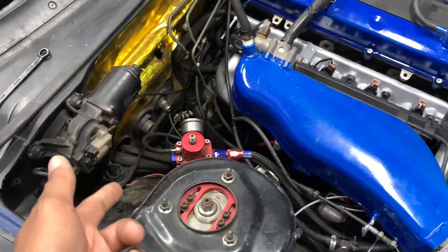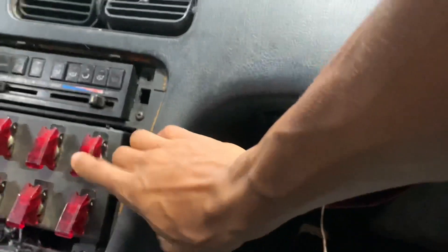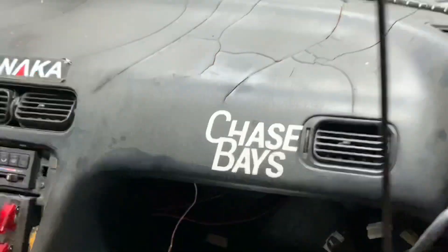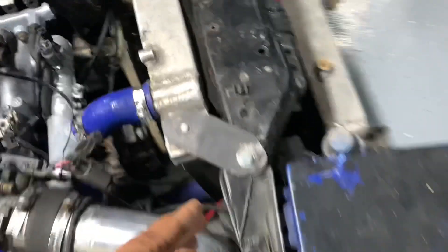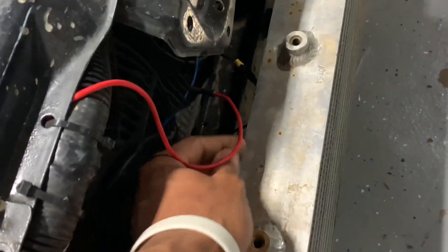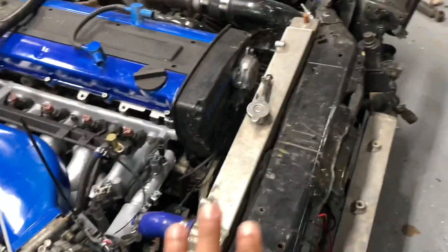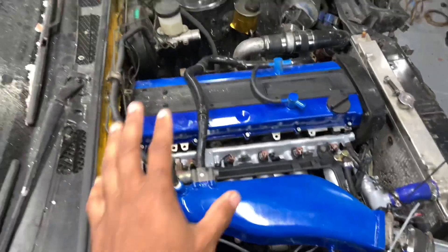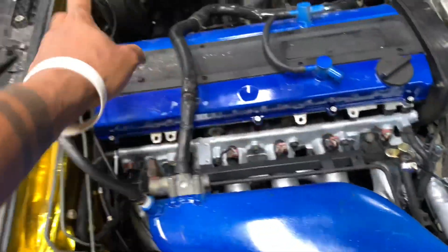I've got to get all that old wiring out, and there's more old wiring on the inside that I need to get rid of. These are the new wires that run to the switch panel for my radiator fan — that's what caught fire. I redid the wiring on that already; it runs through here, up under, and down to the actual radiator fans, so they're fully operational. I'm going to redo some of that wiring and clean up this rat's nest — they're capped off and zip tied just to test and make sure everything works.